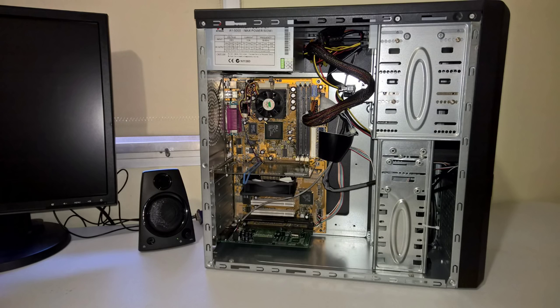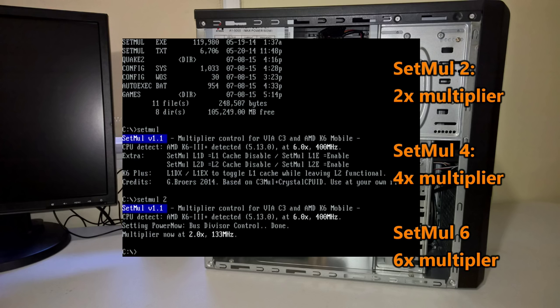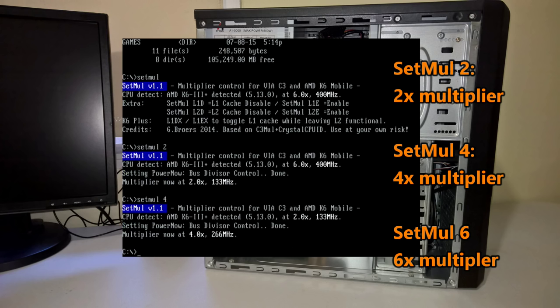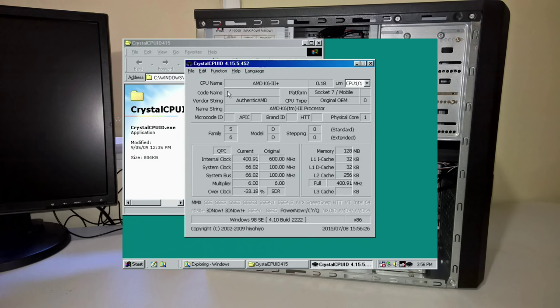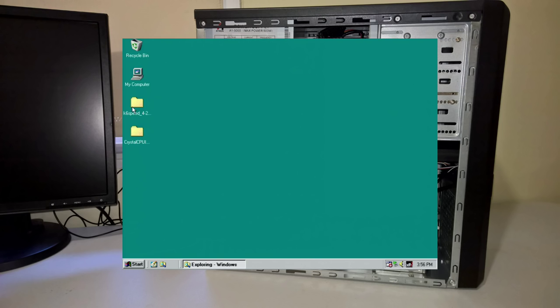In order to change the multiplier, we can also use some software. Again, in DOS, we're using SetMul. Very easy and very straightforward to use. In Windows, you might actually not really have to change the multiplier at all. Just leave it at the full speed. But if you need to change it, there is a Windows utility. I'll also put it down in the description. And we've got some video footage here where you can see how it works.